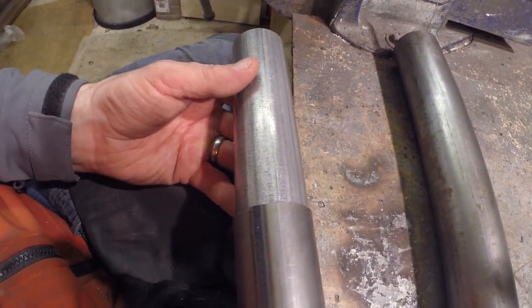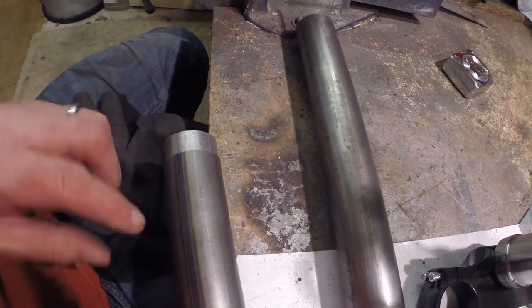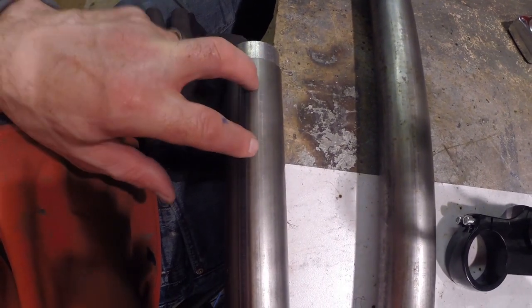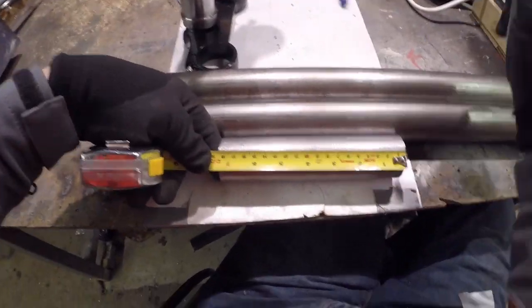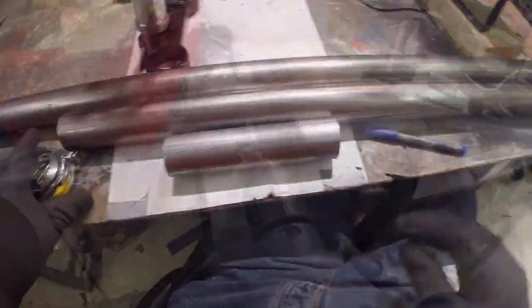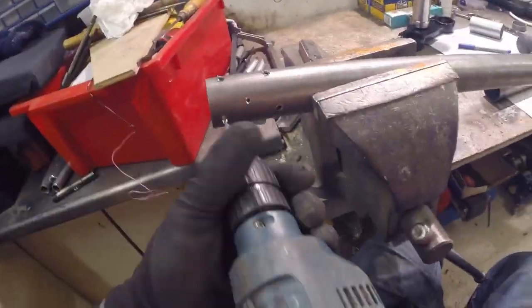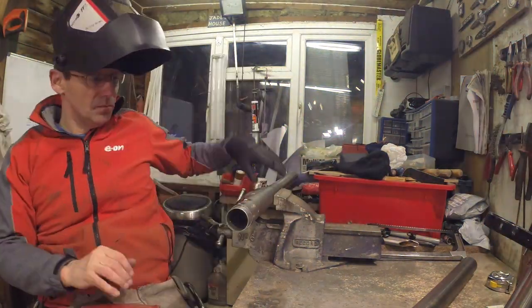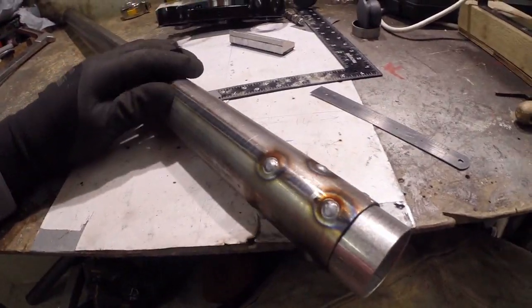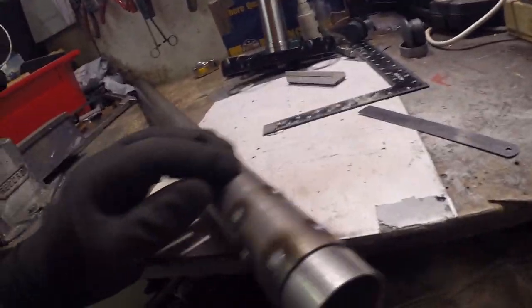Here's the small bit of pipe that slides down inside — I'm going to cut that in half. I'll leave a bit sticking out at the top so we can get it through the top yoke. Then I'll drill a couple of holes, spot weld that round, grind it all off and finish it back so you can't actually see it. That's what the two fork legs look like with all those spot welds in place — I can't see that sleeve going anywhere now. We just need to clean all these off so we can get it through the bottom yoke.